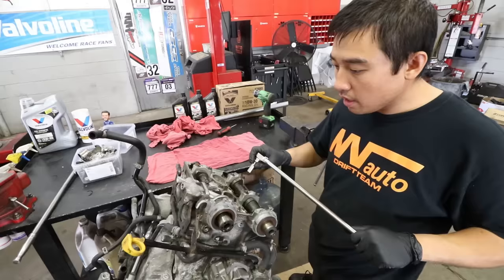It's time for the second moment of truth, because this motor has two cylinder heads. Let's crack it open and see what we've got inside. No holes in those pistons either — that's a good sign. But this cylinder head — we found some signs of seat damage. We'll just pull the valve out and compare these two valve seats: you can see the difference between a good valve seat and one that's got damage on it.